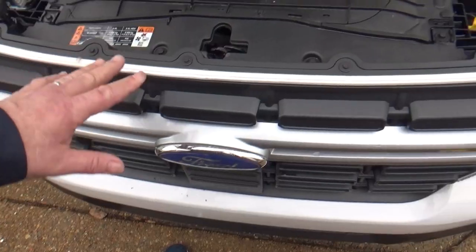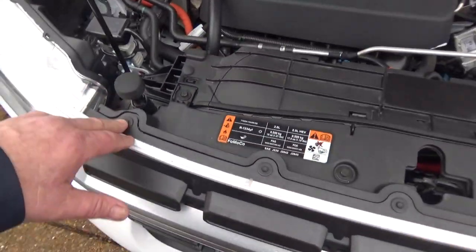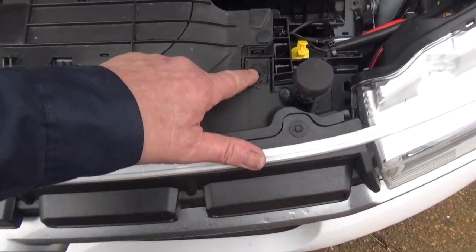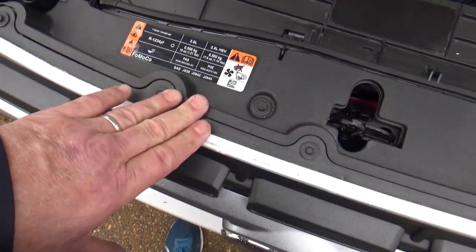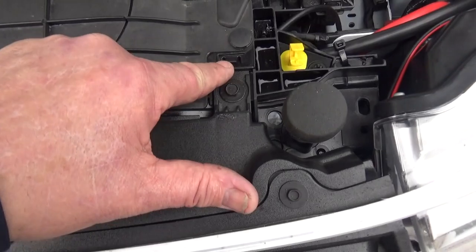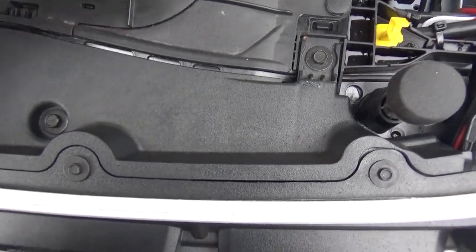Let's get back to taking it off. Here's how we're going to get this grill piece off without removing the front bumper cover, anything under the wheels, or anything else like that. You've got four bolts here — those are 10 millimeter — and then five across the top. We don't have to take those out yet. Take your four out here, and you can see that tab and this tab. That's what holds this onto the back plastic piece and the radiator. We're not going to move that.